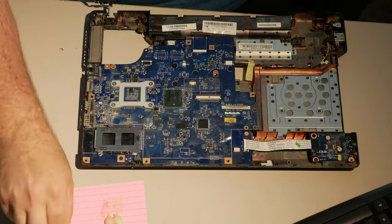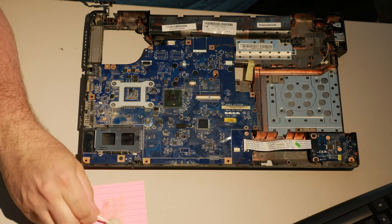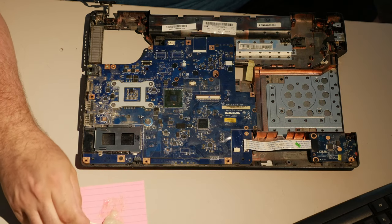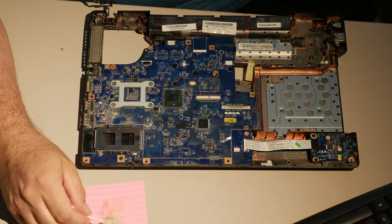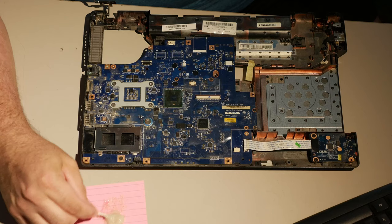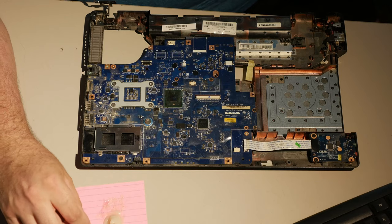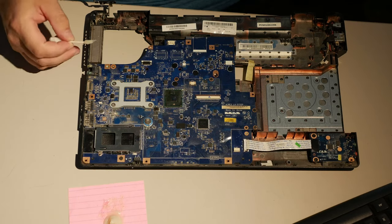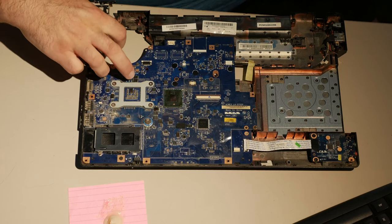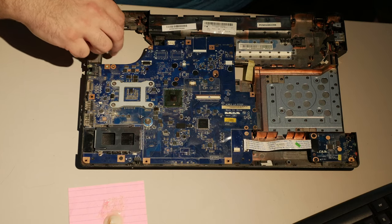So, I have a little bit of need for more epoxy on this stupid Lenovo. I still am marveling at how terrible the design of this thing is. It amazes me that someone made this and thought, this is fine. But at least at the moment, this hinge situation is starting to look up. It needs more build up. This is one of the reasons that sometimes the epoxying just has to be done in stages.